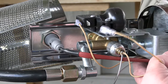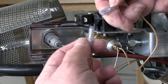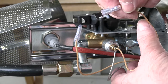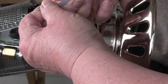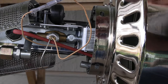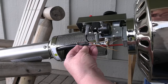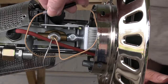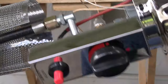I'm always near it when it's on and it has a heavy base, so I'm going to pull these wires out and connect them together to bypass the tilt unit completely. The way I'm going to do that is to use some conductive wire to connect these two connectors and then wrap it up with electrical tape to make sure it's nice and secure. Then tuck everything back inside and put it all back together again.